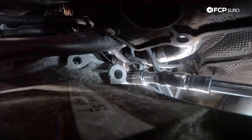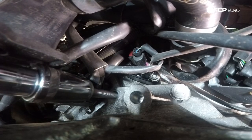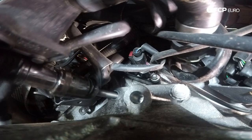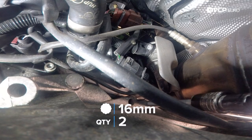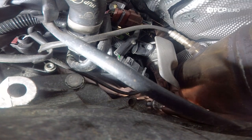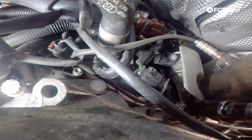So now we're going to go ahead and feed the top two bolts. Same deal — we're going to go for the bolt on the left-hand side. These are the top two bolts once more. Now we're going to go for the two bolts — we have the upper starter bolt as well as the one to the left of it. One more bell housing bolt — leaving us a total of two left.